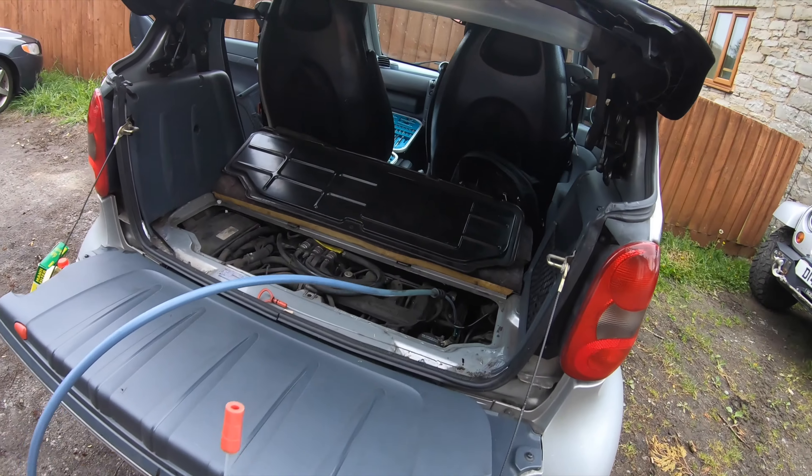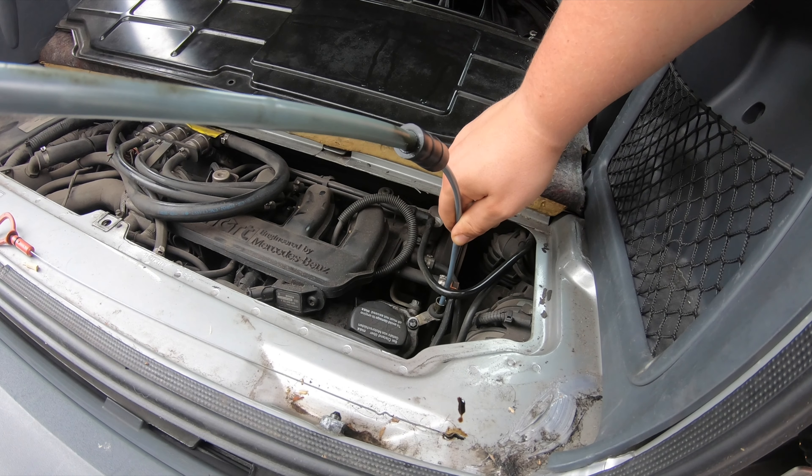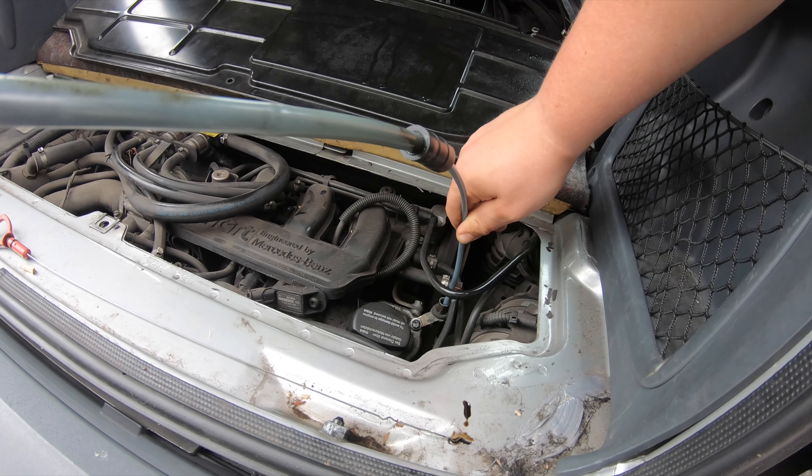You can see the oil is running low — we've got some air coming through. We've had nearly two liters out so I'm just going to adjust the tube. What's happening is the tube's going in and curling around so the end is above the oil level. You just adjust it to really get all the sludge and rubbish out of the bottom of the sump — slowly put it up a bit at a time. When that trick no longer works, that's when the car's empty.